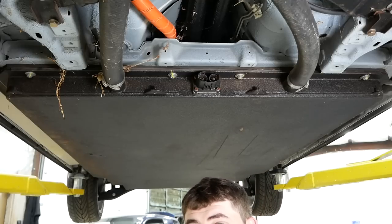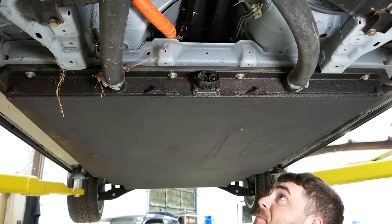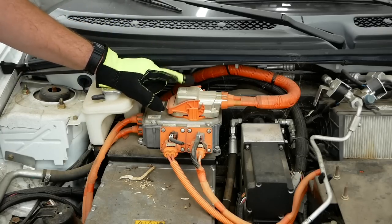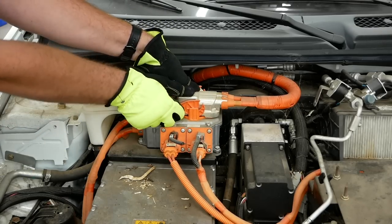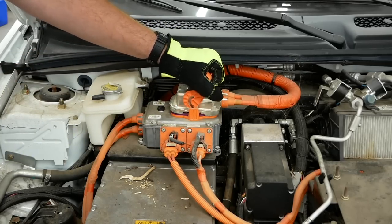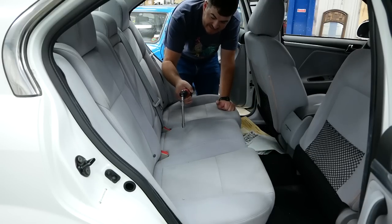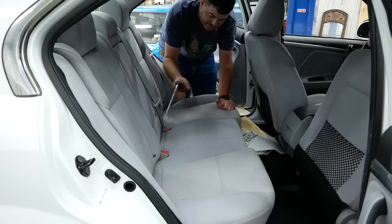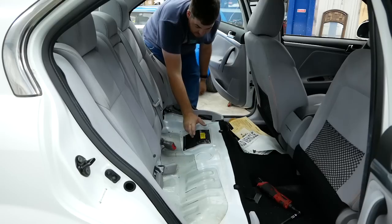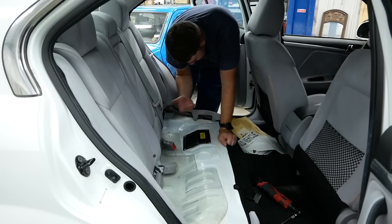The 12-volt battery has been unplugged for about five years. The next step is to remove the manual service disconnect from the front of the battery — there's nothing there, so that's done. Then unplug the connector from the front power distribution box — nice sturdy connectors, unlike the Wego's. Now I need to remove the rear seat cushion to get access to the top of the battery pack through an access panel. High voltage — service must be performed by qualified personnel only. Well, too bad.